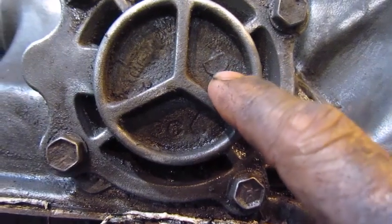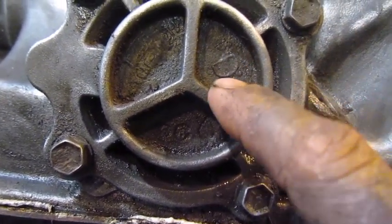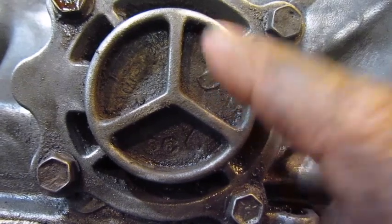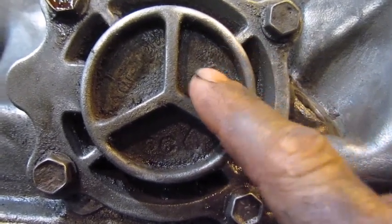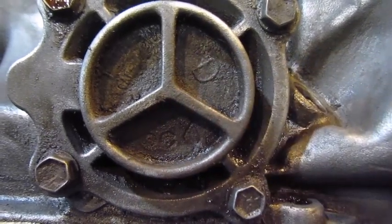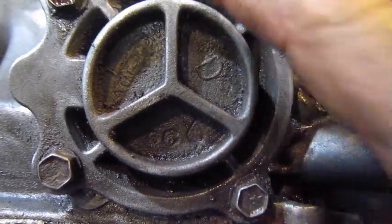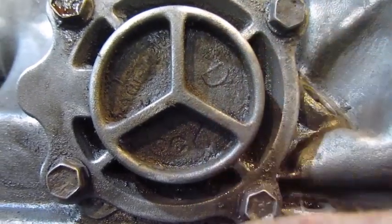And this has got the D, there's L, but the L will be for a car. The D is the hardest shifting one. It'll hold the most pressure. So they put these in the 1-ton trucks and the big trucks. So if you want to firm up your car or whatever, get a D servo, and we'll take it apart now and I'll show you. It's like a piston inside there.